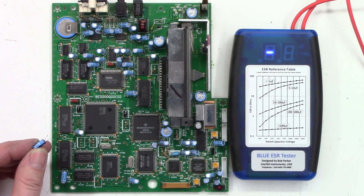I've unsoldered the five main filter caps and they all test perfectly fine. I did a random sample and pulled one cap out of the board — it tests great. So the next thing I'm going to do is go ahead and clean the optical pickup and lube the sled and spindle motors, then pop a disc in and see if it wants to play.